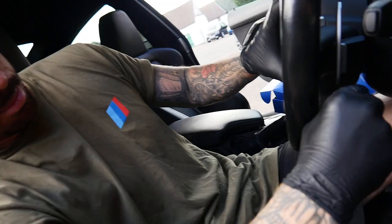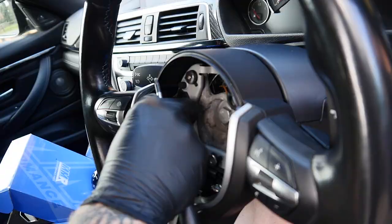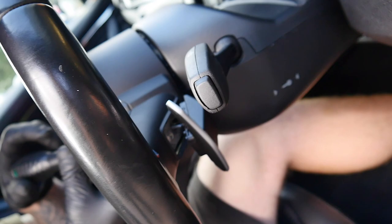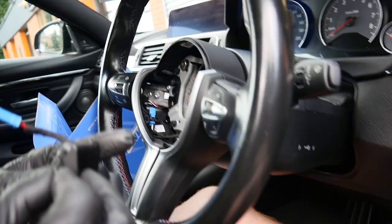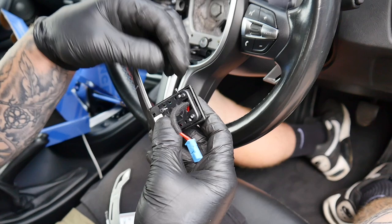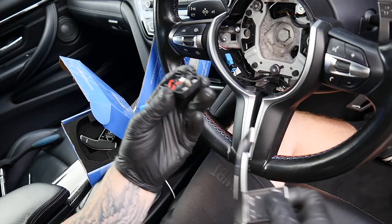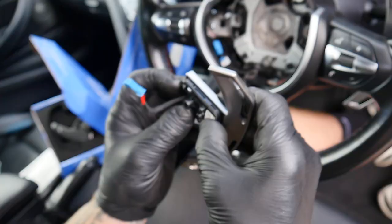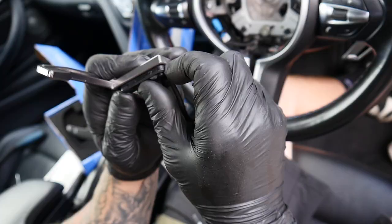Step two: inside the car. There are little poke holes — push them in to pop the airbag out. Mini screwdriver, airbag out, easy as that. We don't actually need to take the steering wheel off. Out comes one shifter, and the other side shifter should come out too. Using a proper tool, the pin pushes out — remember it goes in from the top down. Take it out very carefully, there's a little spring in here, if we lose it it's game over. There we go — that's what the inside looks like, very basic. Here's the new one: bigger, aluminium, looks better, feels better, is better. Put that in the same way it came out. Direct OEM replacement — this is not an advert, it's just me doing mods.